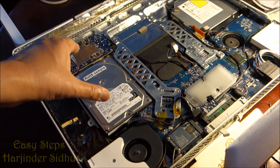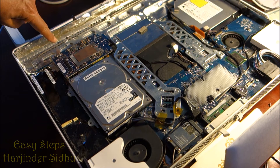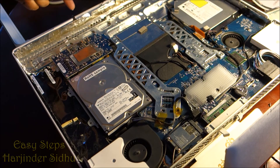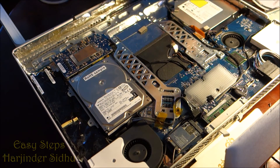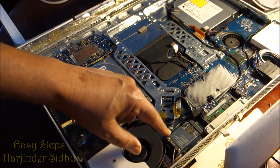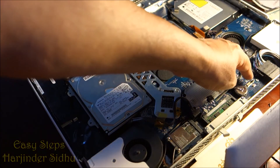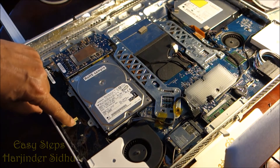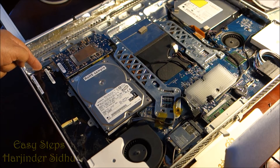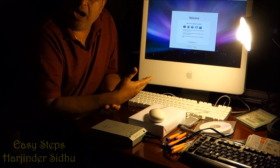I'm now going to replace it. I'll put the new hard drive back in. For reassembly, reuse the tape — press it in with a screwdriver or scribe, and put new tape on the two sides. Reconnect all the connectors including the LCD connectors — there are two on each side — which were hidden before. Once done with this, I'll show you after replacing the hard drive.